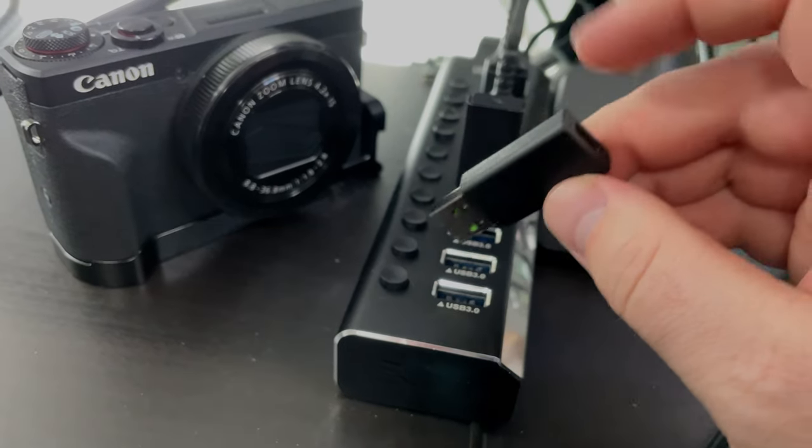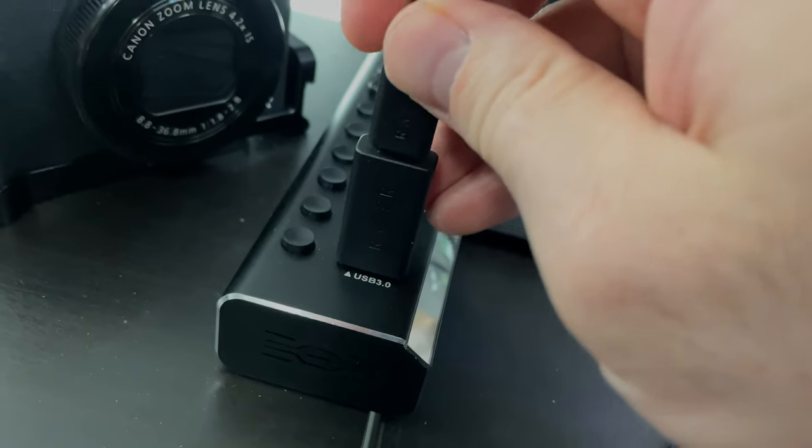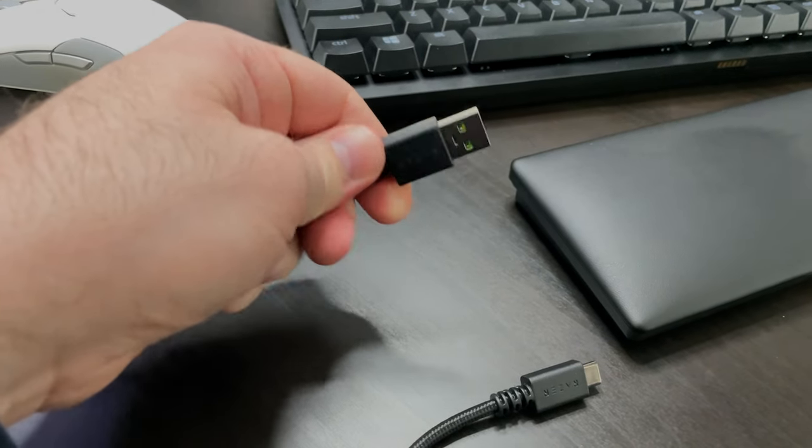But if you're like me, you'll just use the included USB-C to USB-A adapter to hook it up to your system. The second cord for the pass-through port is a traditional USB-A. They also mentioned that both ports need to be 3.0 ports. The reason for the pass-through port is obvious, but the reason for the main one is to be able to effectively power everything with the correct speeds, as you've got RGB lighting, underglow lighting, optical switches that use light that are adjustable, along with the other features. If you plug it into a 2.0 port, you will run into stutters and problems.